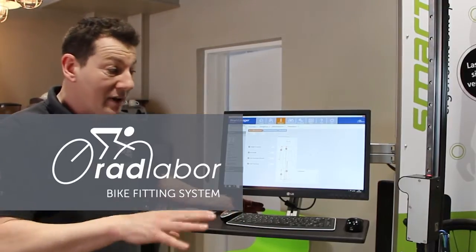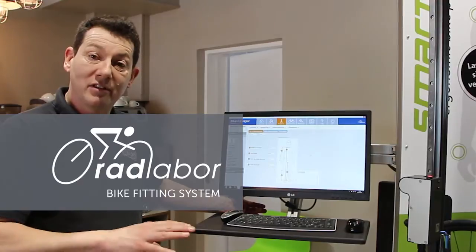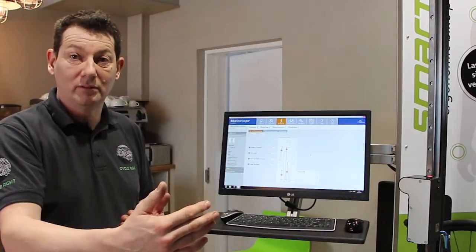length. It's very easy to adjust the saddle height on a bike, and most people think that's the part of the frame we need to measure the most. The crucial measurement is length, because it's the most difficult parameter to adjust on a bicycle.